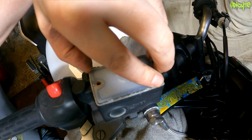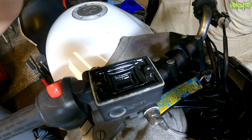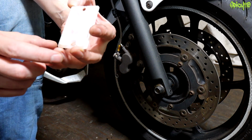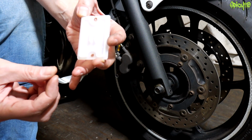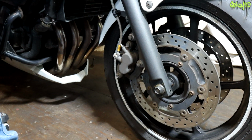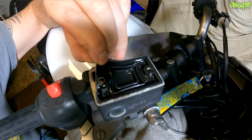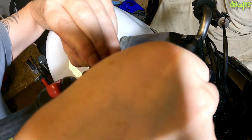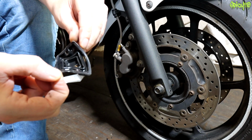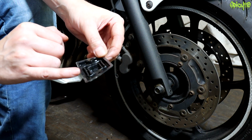Now, what does this stuff in here look like? Is it going to be a nice gold? There's a bit of, oh, just notice there's some moisture under this cap, and that, to me, feels like mostly water, not brake fluid. Right, okay, we might have realised what the issue is. Probably just got to clean up this gasket. Highly suspicious, this liquid on top of the membrane.